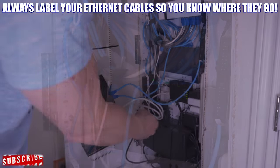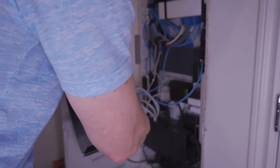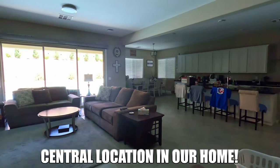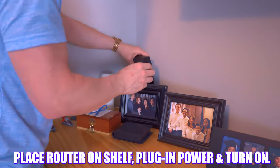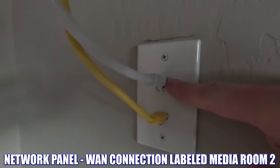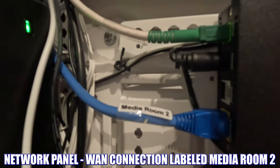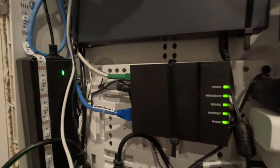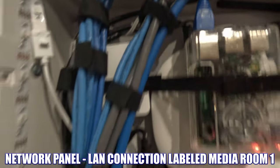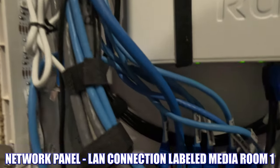First, turn off the router and unplug the power cable and Ethernet cables. Now we'll go to the game room and plug everything back in — here's the new location for our wireless router. This location is perfect because it's in the center of the home in a wide open area. Place the wireless router on the shelf, plug in the power cable, turn it on, and connect the WAN port from the router to the wall port. Now go back to the network panel and plug in the cable from that port to your ISP gateway — you're now connected to the internet. Next, connect the LAN port from the router to the LAN port on the wall, and back in the network panel, connect the LAN port to the switch. This connects our entire network.